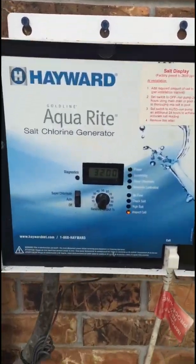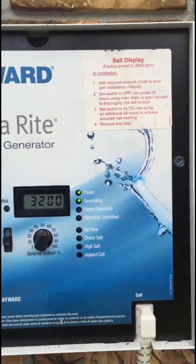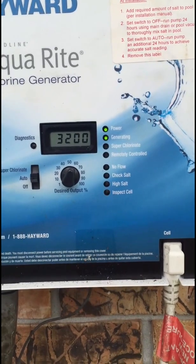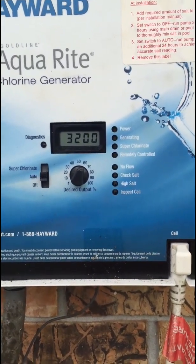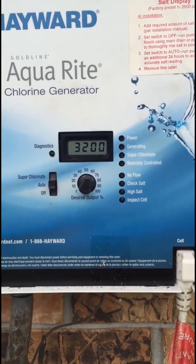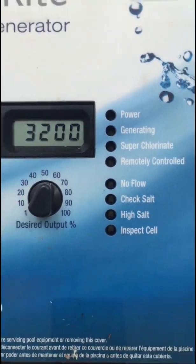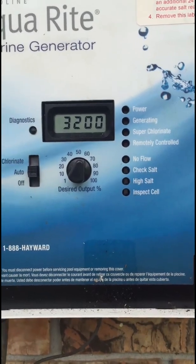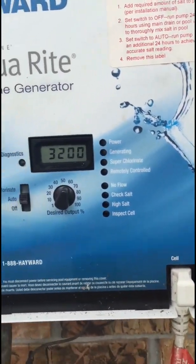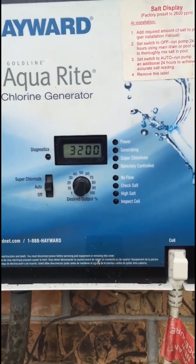That reading is low. The next thing I noticed is that the LED lights were off, but now they're on — and now they're off again. So there looks like there's a problem with the main board on this. Those lights should always be on. The power light is off right now even though the unit is on. And I know from experience that's a problem with the main board.